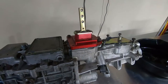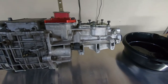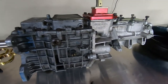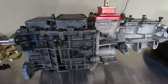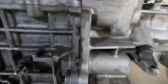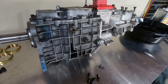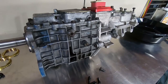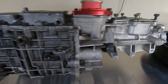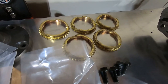I'll probably put this relocated shifter up for sale, so if anybody's interested, shoot me an email at poweredbyford30306@yahoo.com. We're going to tear this thing down and see what it needs. I can tell that somebody's been in here before — it does not have the original sealant Tremec used from the factory. There's some gray silicone between the tail housing and the main case. Tremec used an anaerobic sealant, which dries in the absence of air and is for finely machined surfaces. We'll just have to see what we find. I did buy a brand new set of blocker rings — we're going to put new synchronizers in regardless.